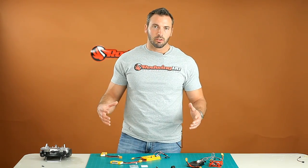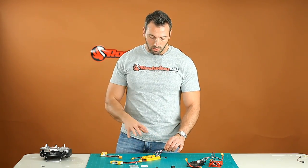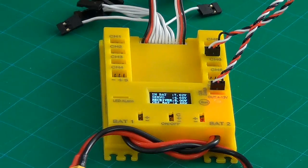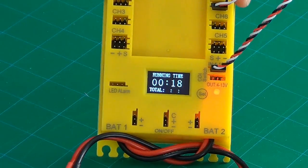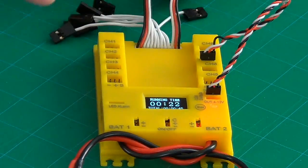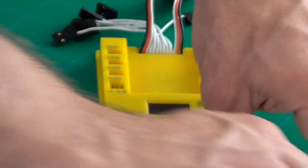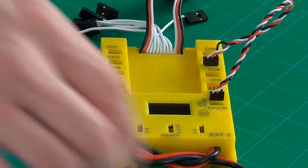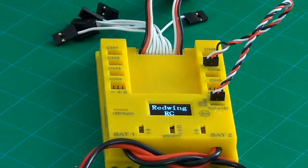And you first have to just connect the receiver, turn it on, and have it activate with the box before the opto-kill will work. So right now you can see that this light to the ignition is staying on, not changing. So I'm going to go ahead and disconnect the power to the box, and you can leave the radio on or off. Once it recognizes it once, it's good to go. And I'm going to plug it back in, just to say, hey, it's connected.